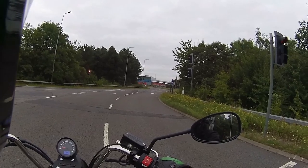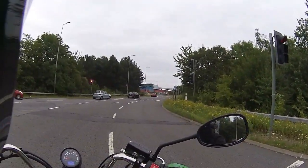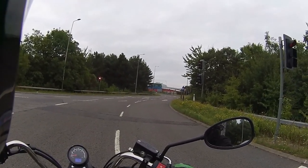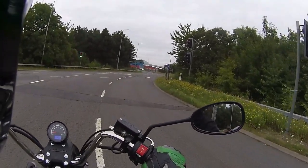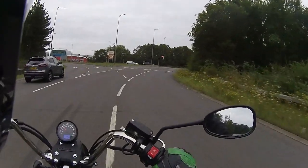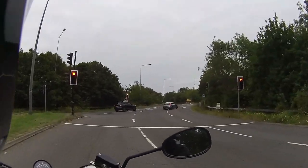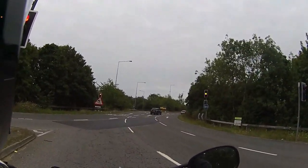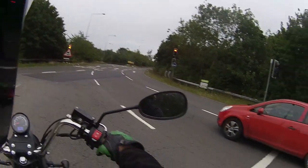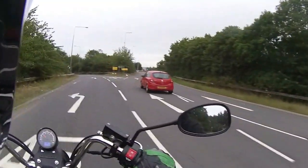Second service then is the same thing again, 3000 miles, and I believe it is 1 year, but the next one is 3000 miles. So when you get your paperwork from the dealer, and you should receive a Lexmoto pack with every bike and a second key in a little black folder, then what you need to do is check your service schedules. That is very, very imperative that you do check all your schedules, just to make sure that you're not going to run the bike out of warranty by missing a service and not damaging the bike.